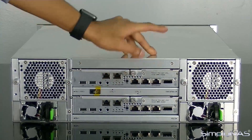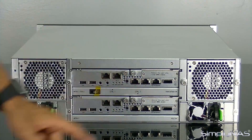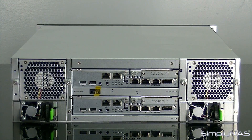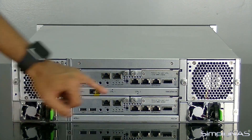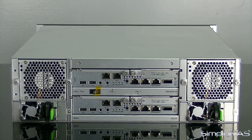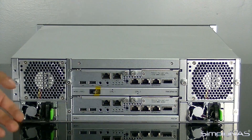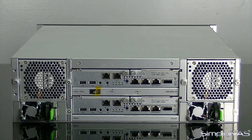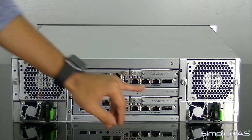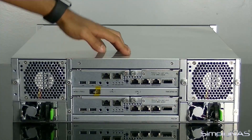Then you've got three RJ45 ports. Port 1 and port 2 are standard, and there's also a management port. You can use it as a typical 1GB port — it does have IP access and internet access, and you can link aggregate it with the other two. It's labeled a management port because when you go into network bonding or an iSCSI connection, we recommend leaving this one open to maintain IP access to the web UI. The console port here is just basic SSH access and doesn't allow web management.